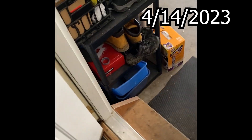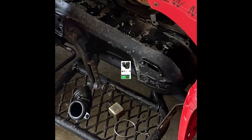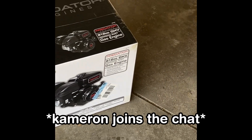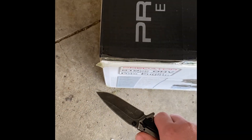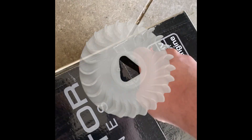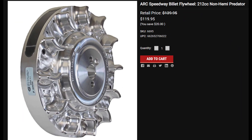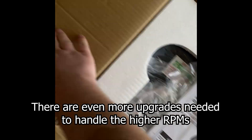Harbor Freight has a Spring Black Friday sale right now, and the Predator 212 is a hundred bucks. Got a 212 — it's going in that. And we're deleting the governor. Little editor's note: I later found out that removing the governor makes the engine spin fast enough to where the plastic fan blows apart. I don't have enough money to buy a $120 billet flywheel, so I'm just going to use the governor as a rev limiter.